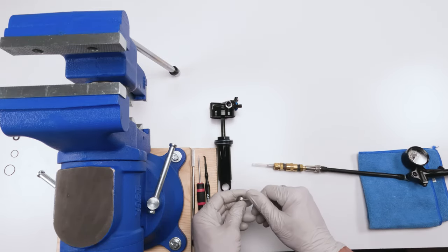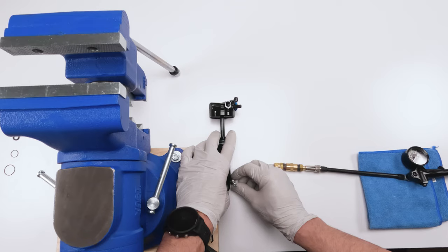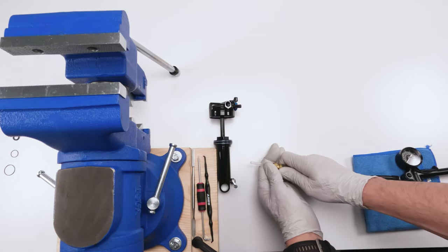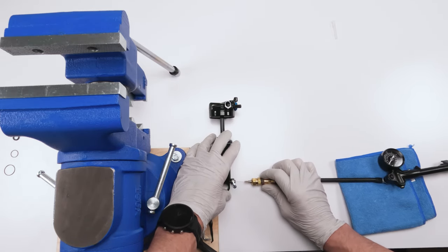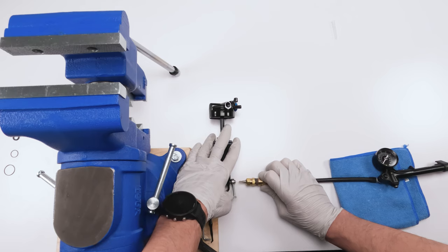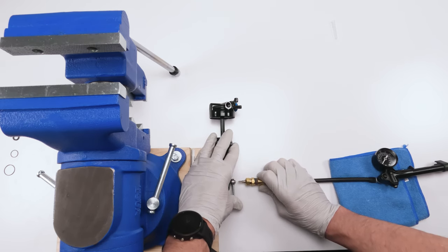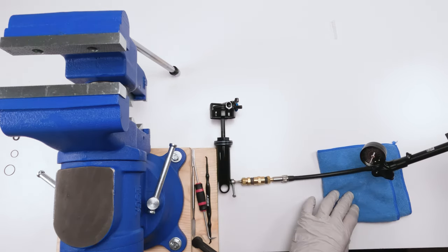So now I'm gonna take this guy, I'm gonna put him in here, okay? Just like that. So be very careful with this needle. Again, this is a surgical, 22 gauge surgical needle. He will go right through you. You will not even realize it, okay? So take the cap off this guy. So now we put him in through the pellet. If he's too tight, if he doesn't go in smoothly, basically loosen the pellet. All this screw is doing is putting tension on the pellet and squeezing it together, okay? So once we take off some of that tension, we should be able to just slide that guy in and then close him up a little bit. Don't close him up too much, okay? So now you have two options.